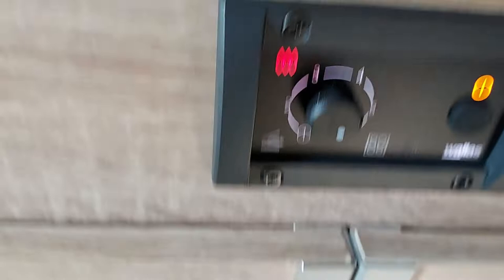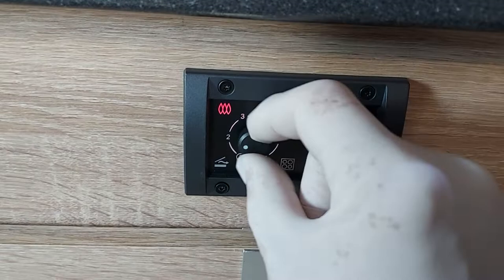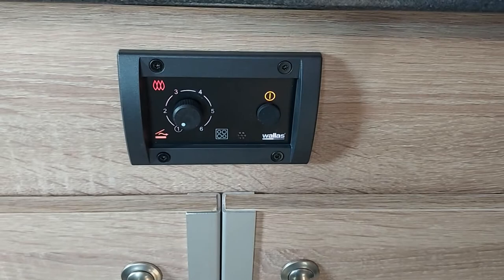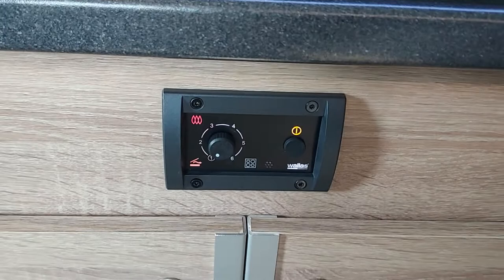For moving to a night heater mode, we simply lower the lid, and on the control panel, we turn the dial until the indicator light for the thermostat lights, usually a couple of turns. So now we're on thermostat for night heater. Usually set on one — you can run through the night on one. It does warm up probably a bit too much on any of the other temperature settings, unless it's very, very cold.